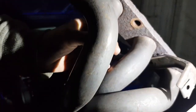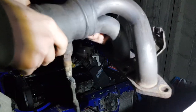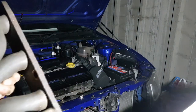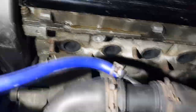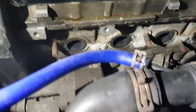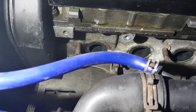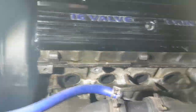The manifold has been defeated, and I want to restore this thing because it's pretty crusty. From visual inspection, there's no cracks - or at least not what I can see. I'll leak test it and see what I can find. Looking at the cylinders, they're quite dry on one side but it looks very wet on this cylinder, so I might have had a slight exhaust leak from the manifold on that side. It feels wet as well, which gives me a bit of concern. On that side it's a little bit, on the other side it's a lot more. We've got to make sure everything's tight the next time we put it on.